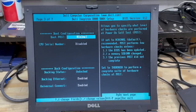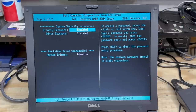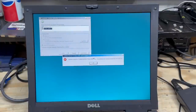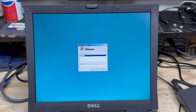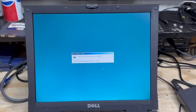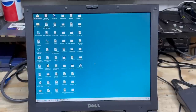Let's go to the next page — looking for display settings. Let's get a verbose post — thorough sounds good. Let's enable the IRDA port, put it on COM2. No batteries installed, and all that looks good. Let's save and exit. We had an improper shutdown — got to go through Scandisk. Zone Labs must be a firewall. I'm just going to let Scandisk do its thing. Got McAfee on it. No complaints from Scandisk. Let's try getting in again. Not the Win9x hardware information database. Detected the infrared unit, and got a reboot. Alright, we are in. This thing has a lot of stuff on it — definitely a business machine. We've got a VPN client.